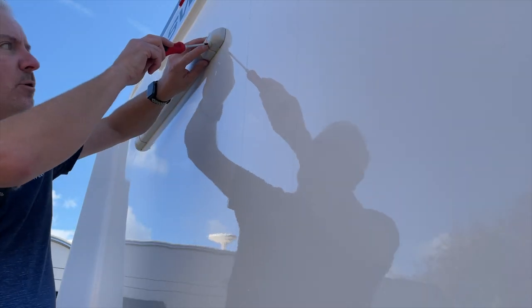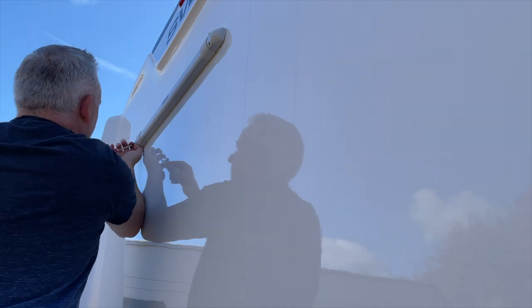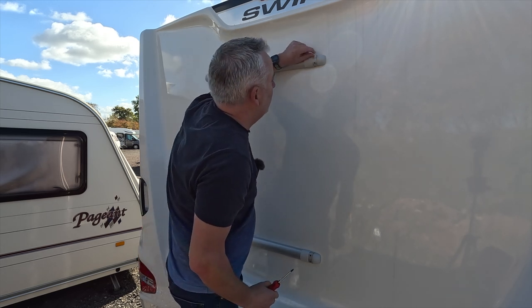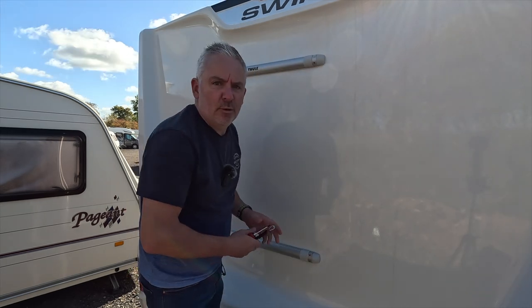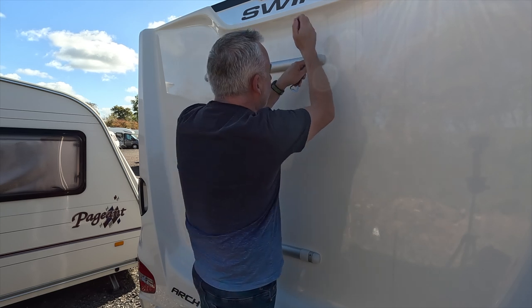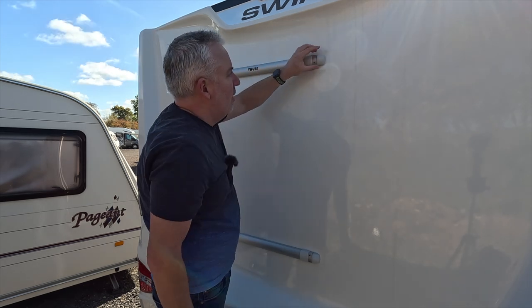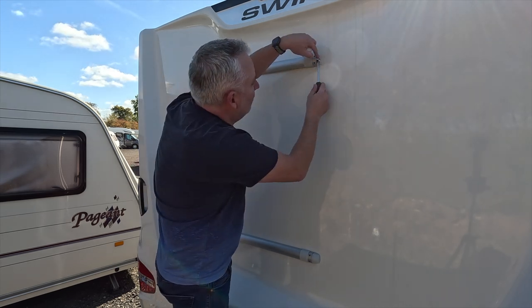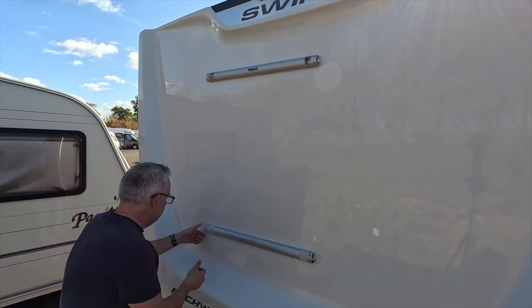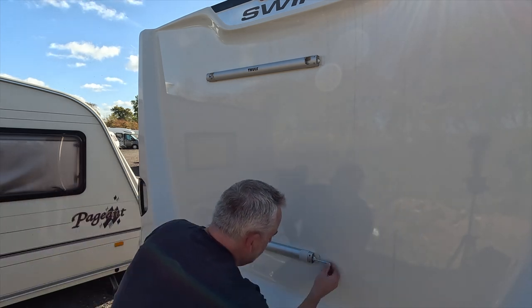So the first thing you need to do is remove the clips and edges and trim off the existing brackets. For that you need a really small screwdriver — this might look big but it's got a really fine point on it. Enter the screw head and hold the collar — with one finger hold the collar, undo the screw, and then the whole thing pulls out. There are a couple that are stubborn — these top two are just turning and not coming out. So I'm going to try and get something just underneath the screw head to give it a little bit of leverage. Because I'm at the storage yard I haven't got all my tools with me, but there's one thing that's guaranteed to be here: a bottle opener that includes a little knife. That did it. I have got new clips in the pack. So now these clips are out, the end piece comes out, and this bar should pull out. The left side came out straight forward. I'm going to give it a bit of gentle persuasion — I think there's a little bit of Sikaflex holding it in place. There's a bit of excessive sealant holding this bar in place and with the screwdriver I'm just going to try and gently release this. Yeah, it comes off straight and easy — just a bit of excess Sikaflex.